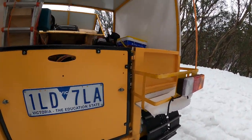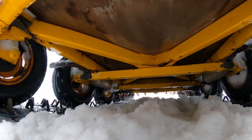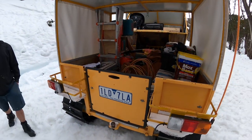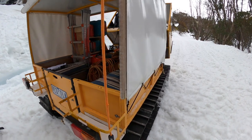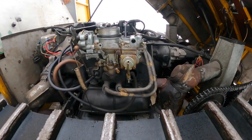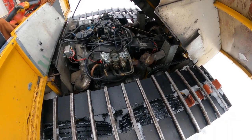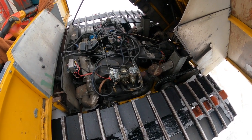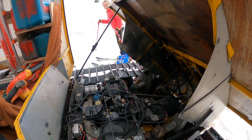Let's have a bit of a look underneath — interesting to see what's under here. She's just a box chassis. You can see the exhaust pipe over there on the side, and another one just up there, a little canister. Very cool. I tell you, this is something you don't see a lot of, and especially that it's a custom-made unit for up here. I love the way that tilt front just exposes the motor like that — really easy to work on too. You can get to your valves to do your valve adjustment. Have you done a valve adjustment on it? Every 3,000 miles you're supposed to do a valve adjustment so you don't burn the valves out. And you've got your little fuel filter down the back there. That's pretty cool.